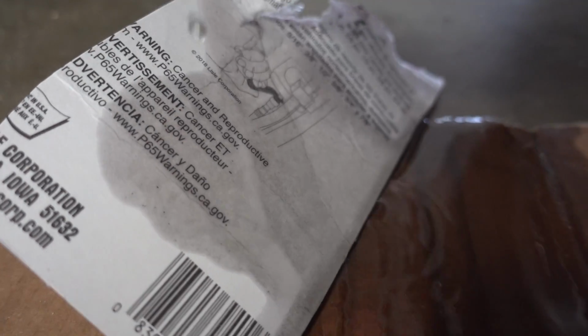Well, hey, thanks for watching this video. That was swapping out that fuel filter on this 03 Chevrolet Suburban. It's got the Z in the VIN, which indicates it's a flex fuel vehicle, so definitely you need to get the filter with that quick disconnect fitting on one side.